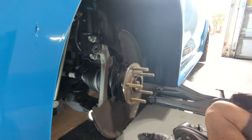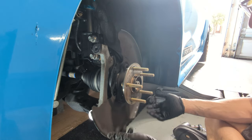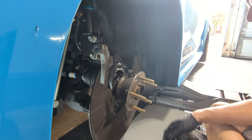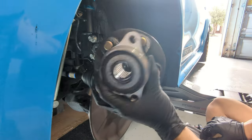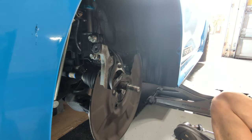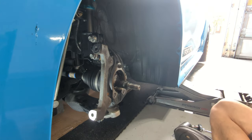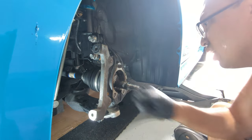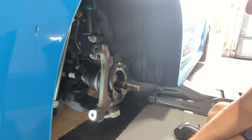Once you get the 3x19mm loose, just go ahead and pull off the hub. Hopefully you're watching this within only a year or so of the car being out, so the hub actually came out fairly easily. Just go ahead, pull that out and set it to the side facing down. Go ahead and pull off the factory heat shield. While you're in here, just go ahead and clean off any dirt or grime in there — that way it makes sure the hub constantly comes out pretty easily.